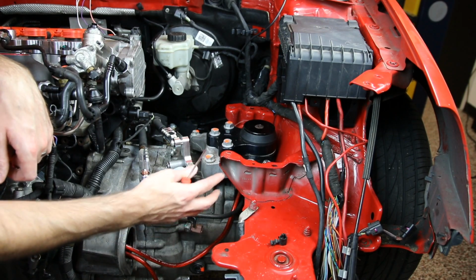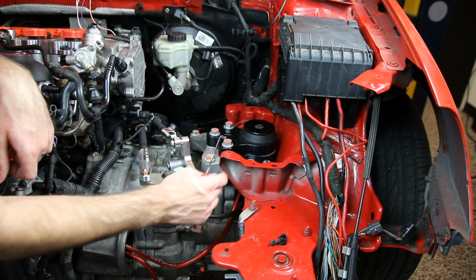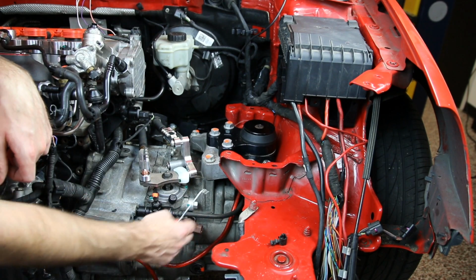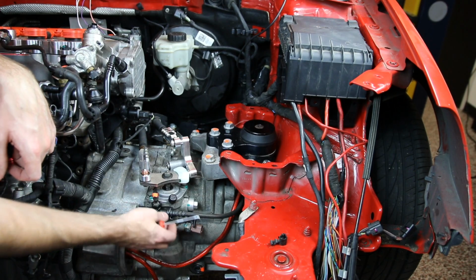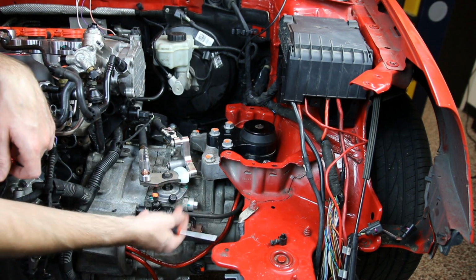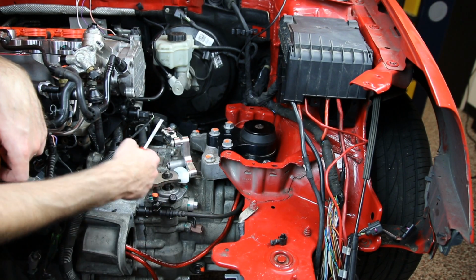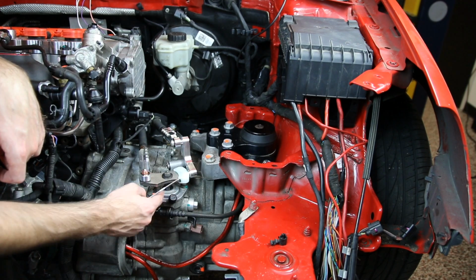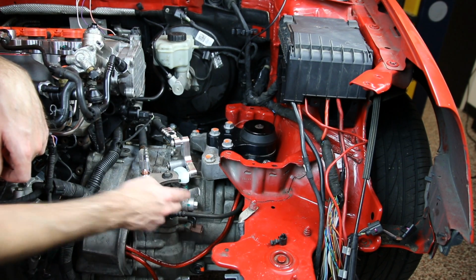Now we are going to be taking this line and putting a stainless one in place. This is one that was given to Max by a buddy of his. We're going to have a solution on this coming pretty soon, along with some options for a bleeder block. We'll have links in the description. Essentially, this bleeder block goes to the slave cylinder, which is also the throwout bearing, and this is where you would bleed the fluid out. We're going to be taking this line and making it stainless.